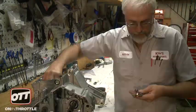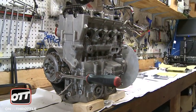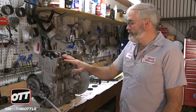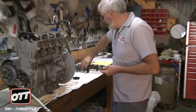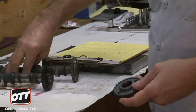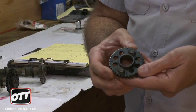We're going to give a short demonstration of how to set cam timing. This particular motor we're going to be working on today is a 2006 GSXR 750. Suzuki production parts have a cam sprocket that is a non-adjustable part that presses on the end of the stick. That is removed and an adjustable — in this case available from APE — adjustable cam sprocket is used.